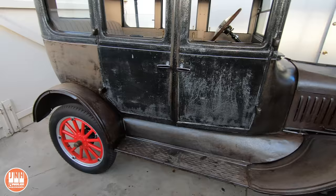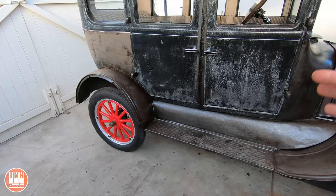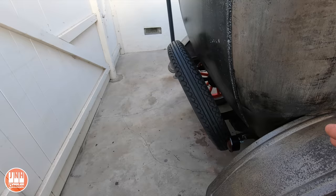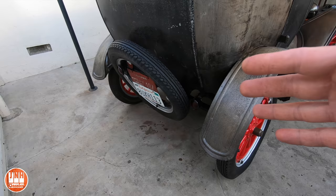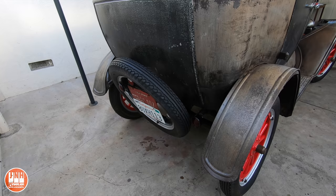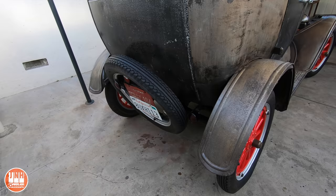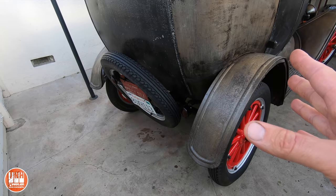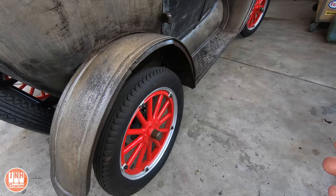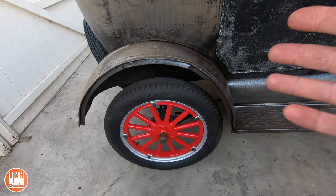I'll go over what took place in that video and what's happened since then — things you didn't see. I pulled the rear end off. I didn't do a full rebuild on it; that was never my intention. In fact, I'm not even positive I want to keep this rear end — I may try to get a Ruckstell rear end, which has two extra gears. I live in a hilly area and that may make the car much better to drive. I had to replace some of the thrust washers and some of the bearings. One bearing was bad and two were kind of worn, so I replaced those. I added the brakes, which have actual modern brake shoes on them, so you can use them to stop the car — that's going to be a good safety feature.